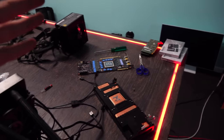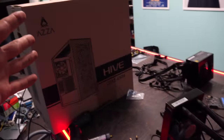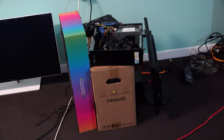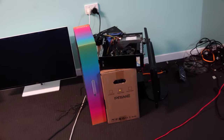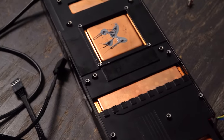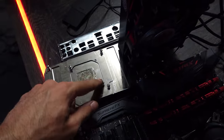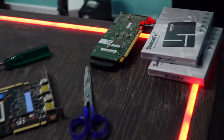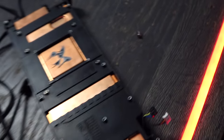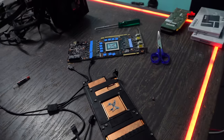We now finally have all the parts here on the table. We've also got two one-terabyte SSDs to build out these two PCs. One will be a standalone PC — that's the 2080 Ti build — and then there's the RTX 3050 setup, which includes the keyboard, mouse, and monitor. However, we've come into a problem already: the AliExpress cooler's threads don't fit the water block's screws, nor the screws from the OptiPlex. I pulled out a Quadro and the little screw doesn't fit either. So I'm going to have to run down to the hardware store before they close and get the right screws for this cooler.